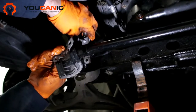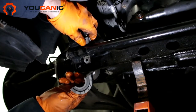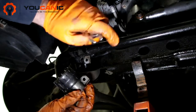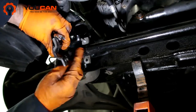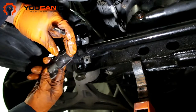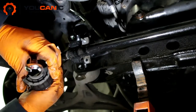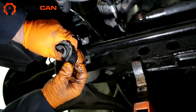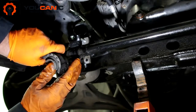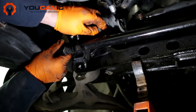There is the lower bolt and the bushing. In this case it's not really too bad. As they get worse, there's a lot of play and a big gap between the bushing and the sway bar. This one isn't too bad, but as you can see it has started to separate — they can seem fine but they're starting to wear, so keep that in mind.